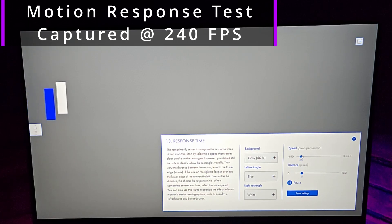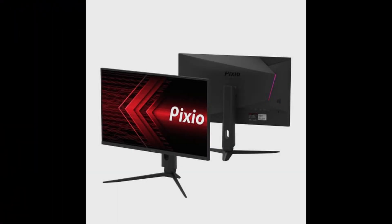When comparing it to the LG OLED, yes the LG OLED is much better, mainly in my opinion due to the HDR. You can activate HDR on this display, although I never recommend it on something that doesn't support at least 800 nits of brightness — even then, brighter is better. One side note I only just remembered: there is an RGB light on the back of the monitor. You can turn it on or off, but you'll have no specific color control.